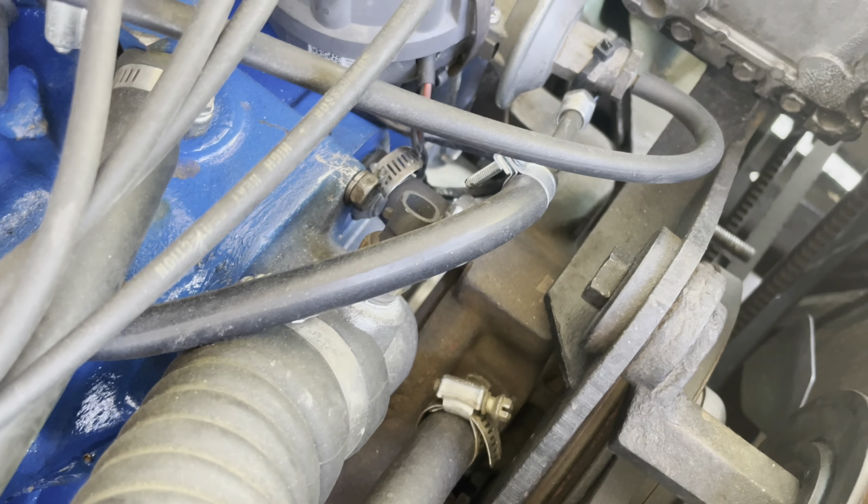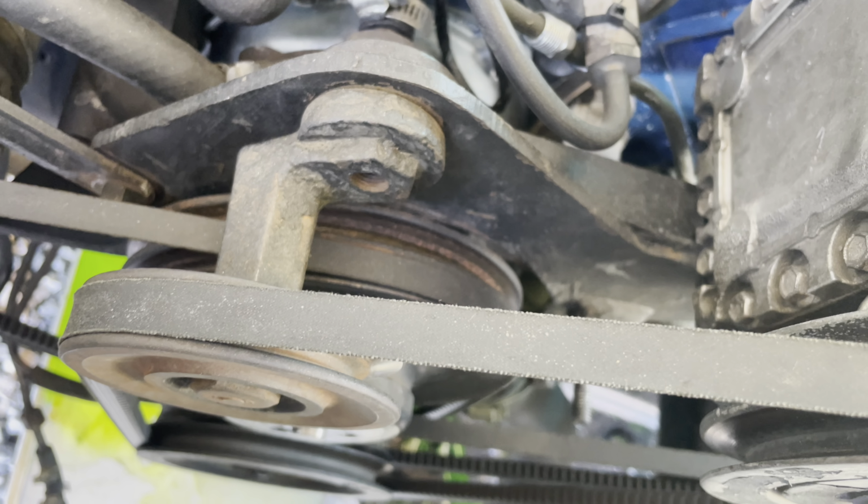That's cute. Looks like somebody forgot to adjust the alternator. That's flopping about aimlessly. And that's the only one that turns the water pump too, so that's absolutely lovely. It's actually supposed to be 2 belts there, but it's fine. So now I need to undo our alternator. Get those done. Coming along.